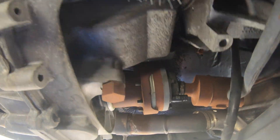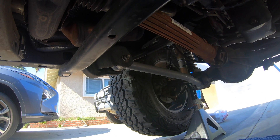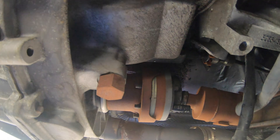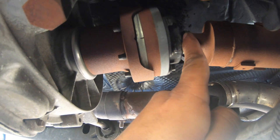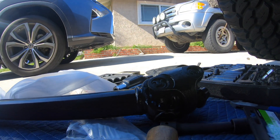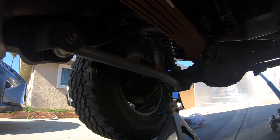So this is why we're changing it. This Jeep has a four inch lift, so it puts extra pressure on this front drive shaft. You can tell right here — this boot, if I can get this closer — the boot is ripped. And you see all the oil that's up top. So because it's at such an angle, that's what's happening. With the new one, we'll have the double cardan, and that'll give us more clearance and relieve that strain.